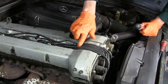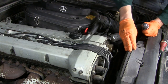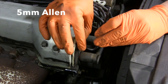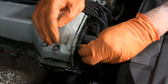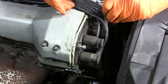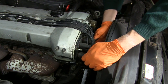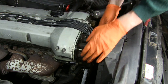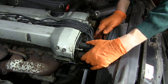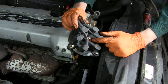The spark plug wires are now easy to get at, but there is a restricted space up front between the engine and the radiator shroud — be careful working in such a tight space. The next thing I'll remove are the three five millimeter Allen head cap screws holding the distributor cap in place. I can then gently lift the cap up, keeping the six spark plug wires still attached. This will allow me to use them as a reference later when I plug the new wires. The center wire to the cap is held behind a plastic bracket, so I will unplug that in order to move the cap up out of the way.